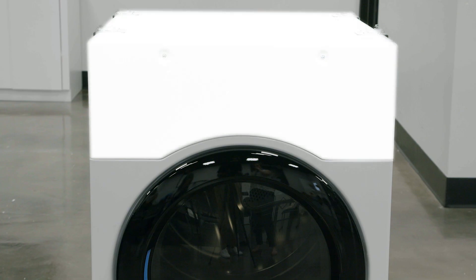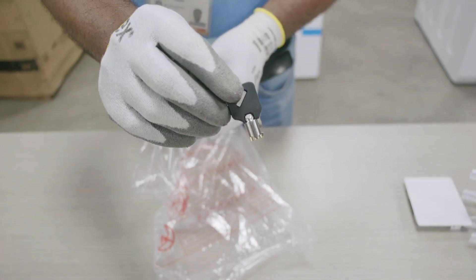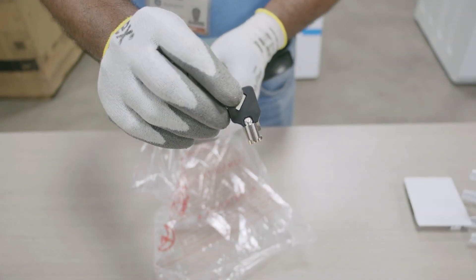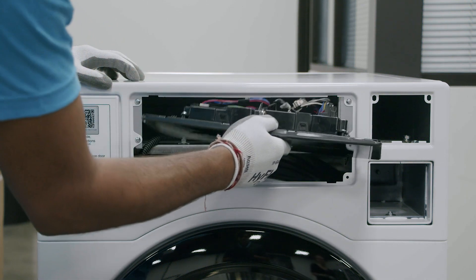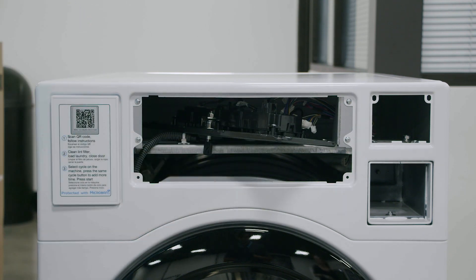Step 1. You will need to remove the top panel from each dryer, as these top panels will be swapped with each other. For the bottom dryer, use the access key which came with the dryer in the accessory bag to unlock and remove the user interface control panel. You can tilt the user interface control panel sideways and tuck into the dryer top shell to allow you to remove the control panel frame without disconnecting the user interface harness connections.